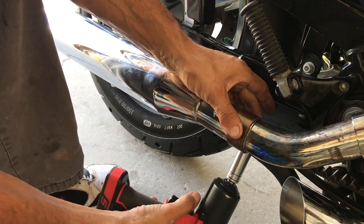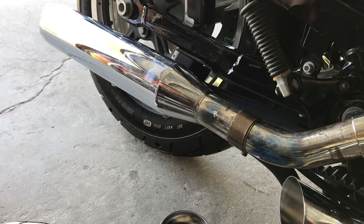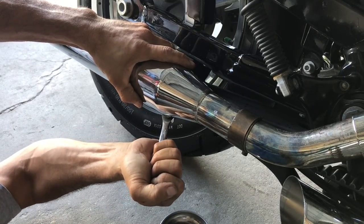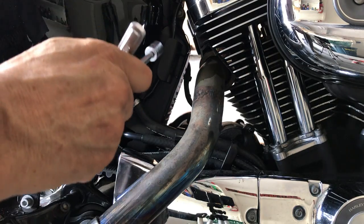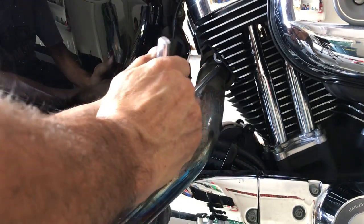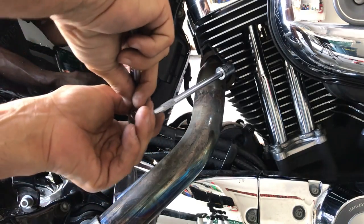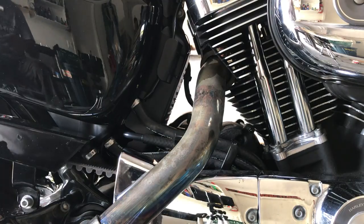Now I'll tighten up this one with the snap-on gun — it really does the job. Now we'll take the half inch and tighten these up. Now to tighten up the exhaust with a half inch ratchet — remember, we just loosened it up so we can move this. Do not take them all the way off, you'll create more work than you need. Hand tight. If we didn't take the shield off, we'd never be able to get to these bolts. Do not wrench these things down — snug them up.